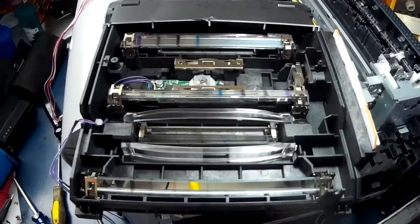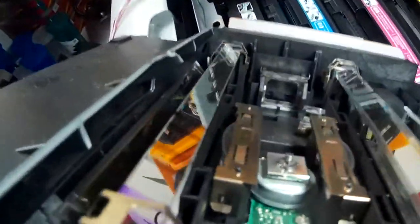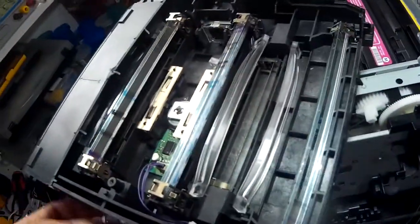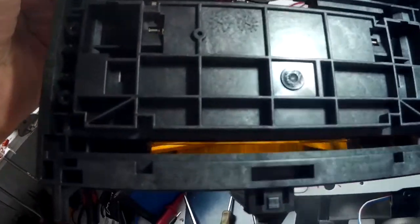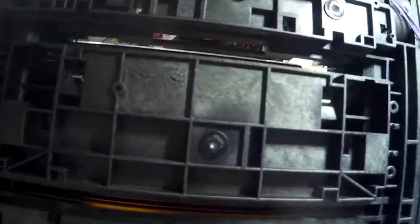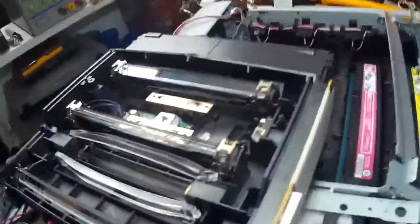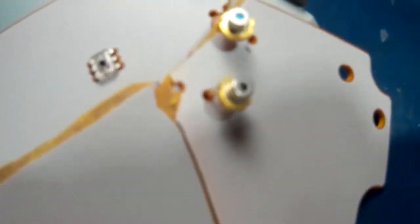Let's take this plate off and take a look at that laser. I got it out — this is actually kind of cool. I thought this had just one laser, but apparently if you look at the laser itself, it's got four in there. It splits it into four sections and has four different shades of glass for different colors — that dark one in there is for yellow. There's the board for the laser. There's no way to get it out without damaging the board, but there are four laser diodes that could be used with lenses.